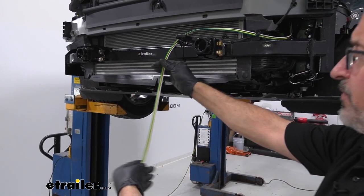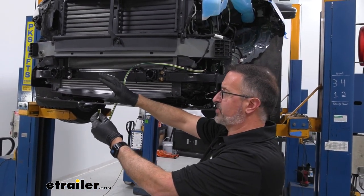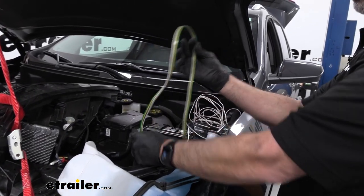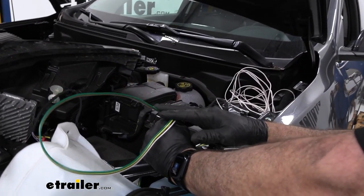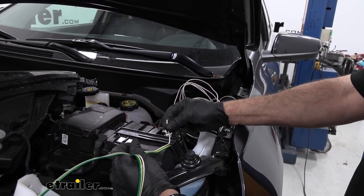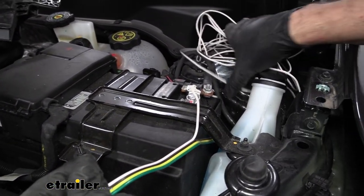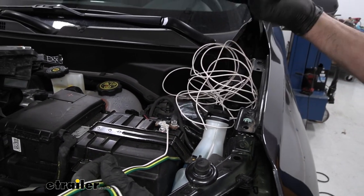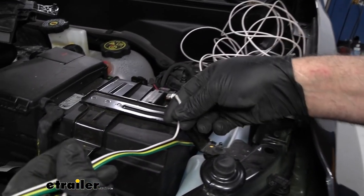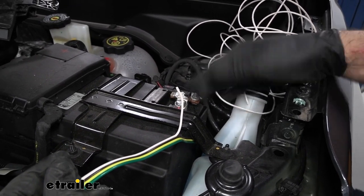We took the wire and left about a foot up here because we're going to be doing some wiring with the seven-way. We came around here and routed this up through the engine compartment. I left a loop of wire here so later on we're going to tie into the auxiliary braking unit as well. Before we run it back down, I went ahead and cut the white wire — we only need to run three wires to the tail lights in the back. This is going to give us extra wire that we're going to need back there to finish our diode wiring — this way we don't have to buy any extra wire. This is our ground and we're going to be grounding this either at the frame or right directly at the battery.